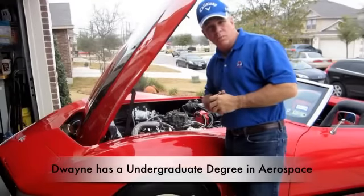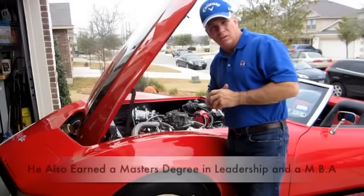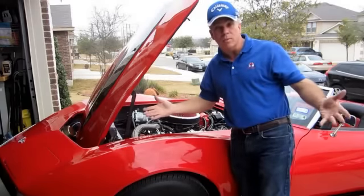Well, there you go. RPMs is just at 750 RPMs. A perfect fuel and air mixture using the needle idler valve. And we'll go ahead and put it all back together. Another mission accomplished. Let's go ahead and start it up and see what it sounds like.